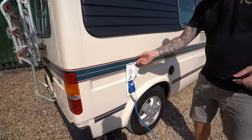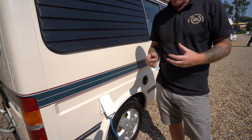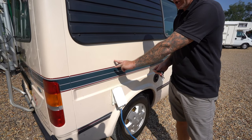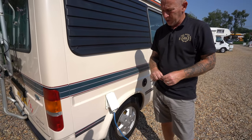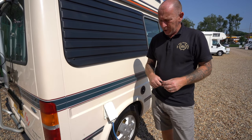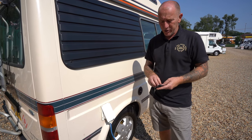Now the front mains lead. When you've got your mains lead in, inside your motorhome you've got 3-pin sockets and also 12-volt sockets. When your mains lead is in the vehicle, all your 3-pin sockets will work, and also your 12-volt. So when your mains is in, no matter what electric you're using on your motorhome, you're never draining your battery. That's why you're paying for your site fees - for the use of the electric.